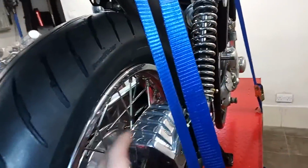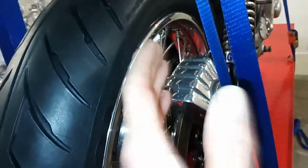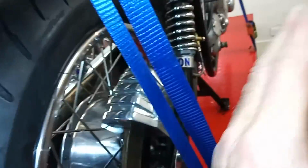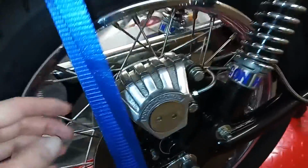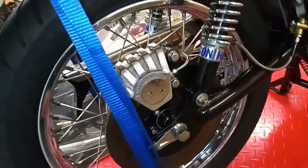Because until I did that, every time I tried to get that in, one of the brake pads would fall out, because they literally just flop about, and you turn it slightly too much one way and one will fall out, and then the other one will fall out. Nightmare. But using that is great. And then you get the caliper on the disc, and once it's on the disc, you can pull that out and everything's great. So that was a good one from the manual.